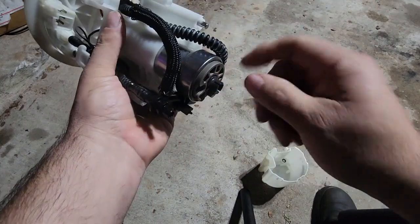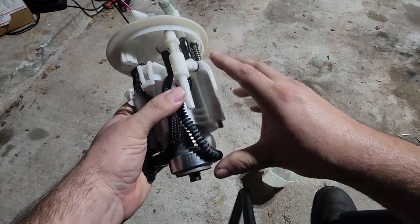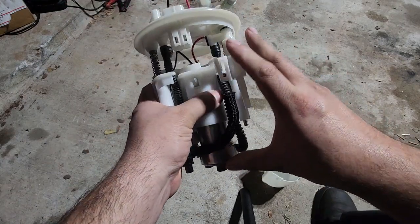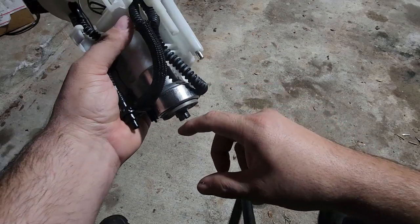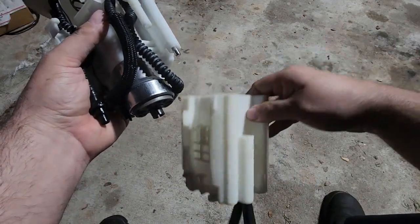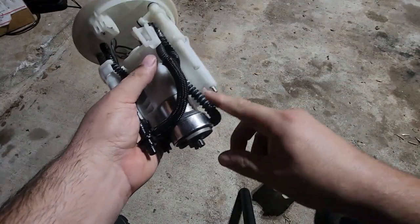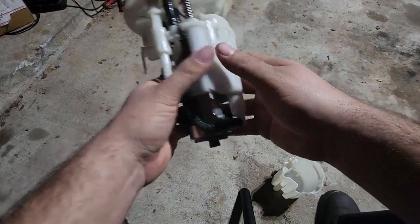It's a very tight fit. But what I've heard online is, when you run these 450s, the people that have put them in say that because it is pretty snug, and if I pull on it, it doesn't want to come out, but I can yank it hard enough to pull it out, when they run high pressure, a lot of pressure in here, the pumps can kick themselves out. So the biggest problem is it trying to kick itself out. And by me putting this spacer on here, this is going to jam it completely back in. And this housing is going to be the lock that essentially holds it all the way up. And by it holding itself all the way up, there is physically no possible way for that 450 to kick itself back out of the double O-ring up here. So I felt like that was a safer bet